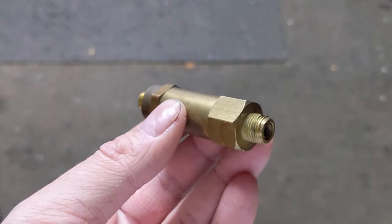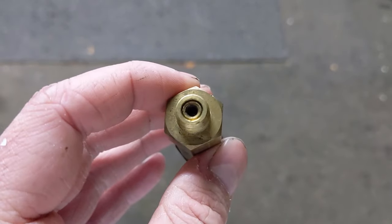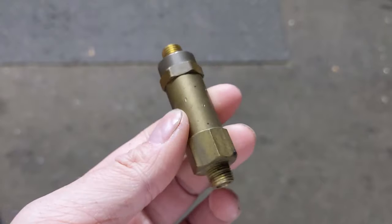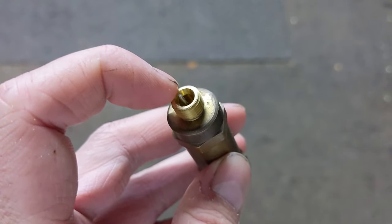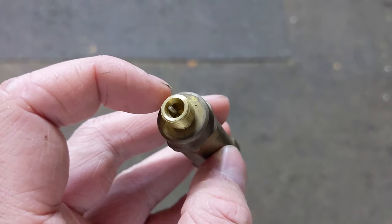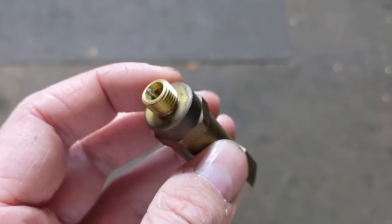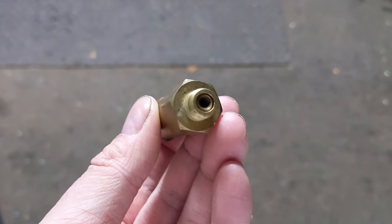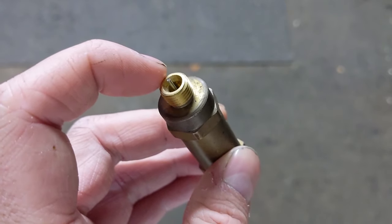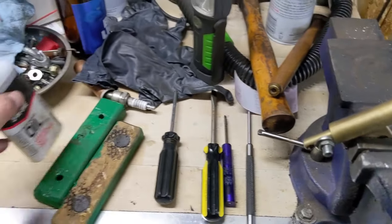Your compressor may have either an air vane piston or a bullwhip throttle control — I call them bullwhip throttle controls whether it's the cable type or the air tube type. The air tube type has the piston up on top of the engine with an airline, while the bullwhip has the piston down at the check valve and runs a physical cable up to control your throttle. I prefer the airline with piston. On this one, the inner tube got corroded and when it went to throttle the engine down, it snapped the cable — so the customer complained it wouldn't throttle up or down. A simple fix is to just lubricate your cable line. I cleaned out the red Loctite and lubricated it with a bit of 3-in-1 oil.